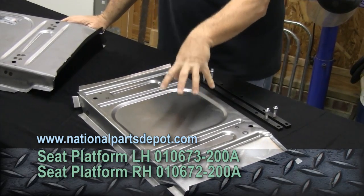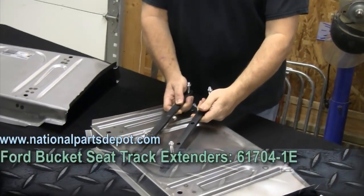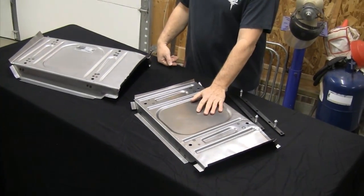If you were a little taller or a little shorter, that was okay. But when you start getting into some of the heights we are now — I'm about six foot, Vince is six foot, Gina's six five, Cam's around six four, six five — the Mustang isn't really a good fit. Now the pan I have over here is the new pan for the Cougar line, and it will also fit in a Mustang. It will drop the seat about an inch. An inch really does make a difference for headroom. And from National Parts Depot, these seat extenders will give you about two inches of additional depth to your seat, so you can pull the seat even further back and won't feel like you're sitting like a monkey inside a Mustang. These will help give you more legroom as well.